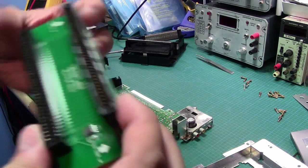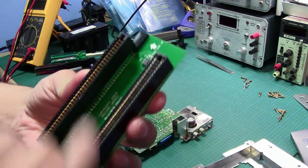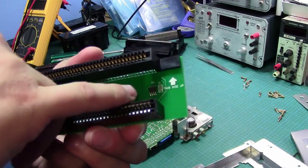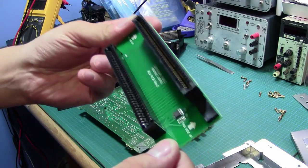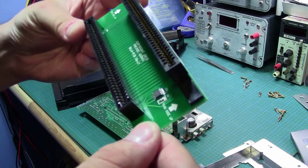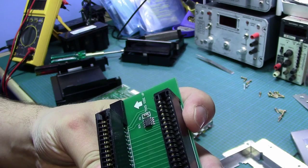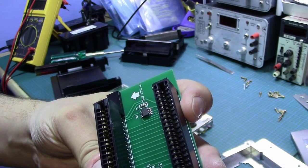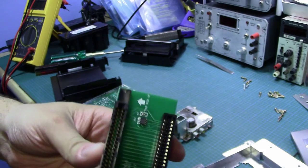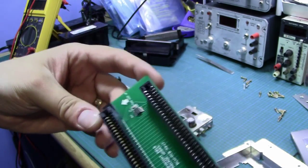Alright, sorry about that. So yeah, again, if we have a quick look here, there's almost nothing on this PCB. There's one cap and an SO8 IC of some sort, and you probably can't see that, but I'll read off the part number, and that is a 12F629 from Microchip. Surprise, surprise. So that's a little PIC 12F.